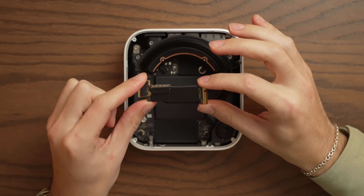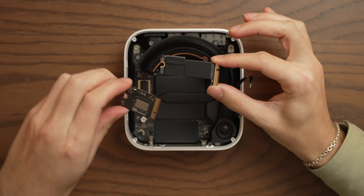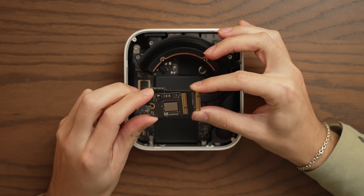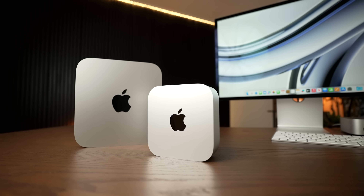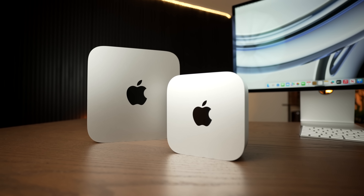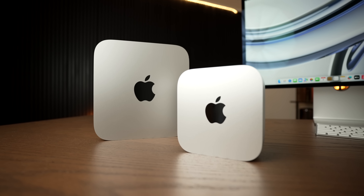That is remarkable. And things will get even easier with the Mac Mini, because the 8TB configuration of the M4 Pro Mac Mini still only uses a single storage module. The very weird-looking new storage card in that machine can handle four 2TB NAND modules, whereas all of the previous 8TB Apple configurations required eight 1TB modules. Do I wish that Apple would use a normal interface and not build the SSD controller into the SoC and create this whole mess in the first place? Absolutely. But given the parameters of the way that Apple Silicon has been designed, we know that that's not going to happen.